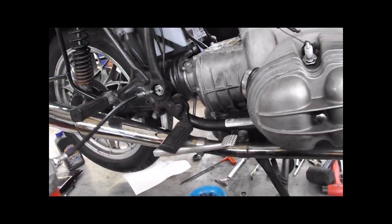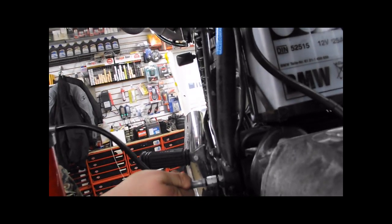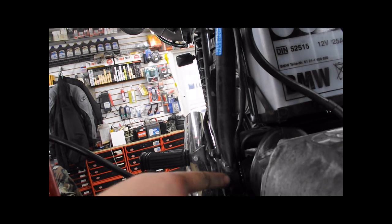We're going to take our grease gun. So you can do this one-handed. And pump. You already torqued the center? No, I did not torque this. I don't know if that's going to show up in the video or not, but I got to hold both of this. You hold the grease needle in, keep pumping until it starts to come out of the pivot joint. You can see right in here. See it pushing the grease out? That's what you want. Take your cap, and everybody's happy.